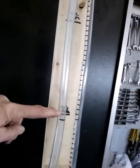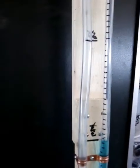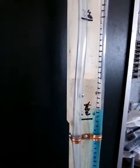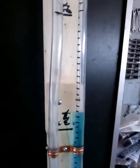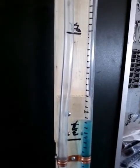Next one is two times, that'll be 80, 120, 160. We'll have to see if my little vacuum pump will do it. Should be able to do it. I think that was the back going. Same story. Tailpiece here gets sucked in. Normally it's pushed out. It's convex and it gets sucked in as concave, makes a big racket. And now we'll be testing the drum itself.